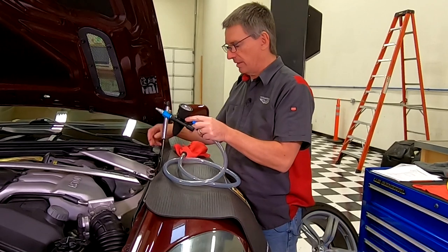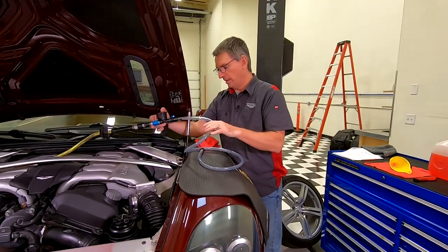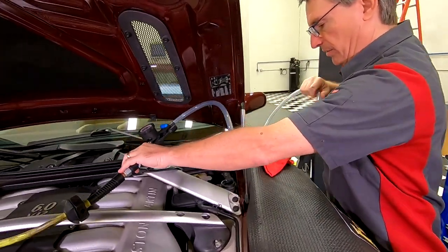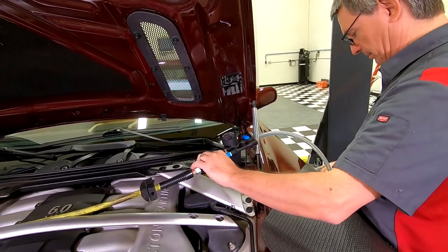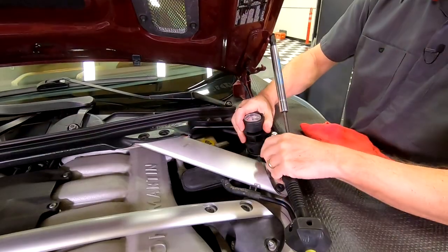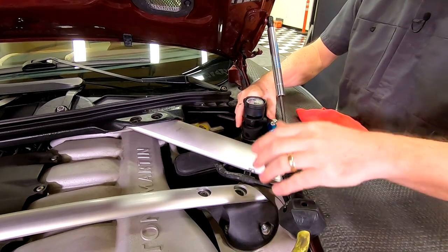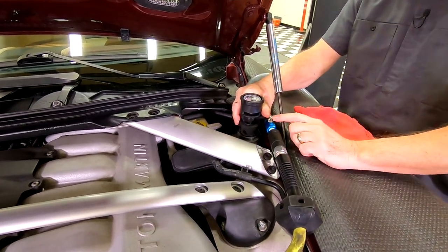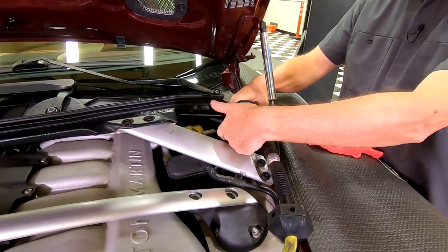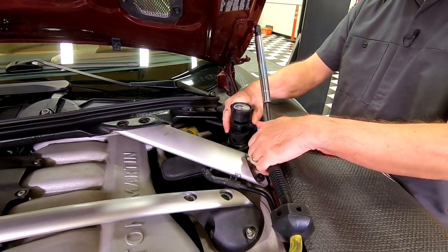The first step is to hook up compressed air. I'm going to orient the system so I can have my hose hanging over the side of the car. I'm going to get the plug in there as best I can. Compressed air is on, and as soon as I push this button it's going to start running air through - a Venturi effect is going to start sucking the air out of the reservoir chamber. We should probably see the hoses collapsing, and I'll be able to watch the vacuum build up on this gauge.